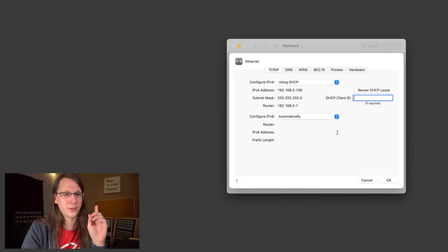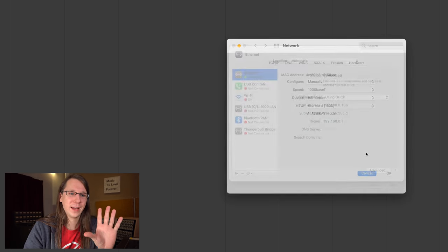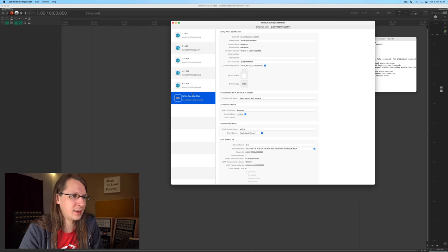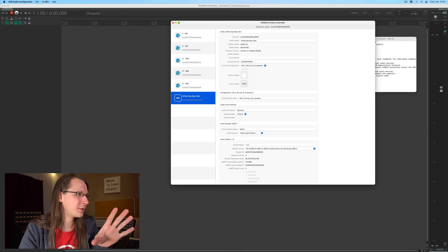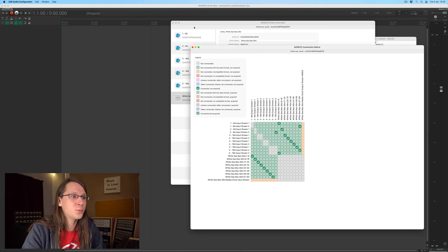If you want to run AVB on your Mac — and I think a lot of Macs have issues with AVB — here's a workaround. Go to your Ethernet connection, then Advanced, then Hardware, and set your configuration from Automatic to Manual. Just do that and keep everything else the same. This should be in AVB mode, but on Manual it works stable. On Automatic it's just not stable — it sometimes creates two different domains and you get two tabs you can't combine. But on Manual it just works flawlessly. It connects automatically every time I boot up or reboot.